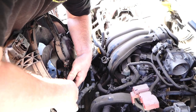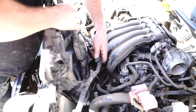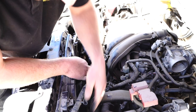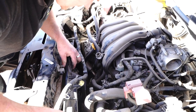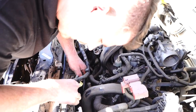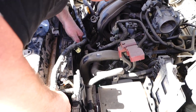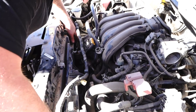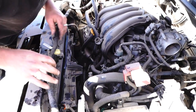Wiring loom up and out of the way. Dropping the fan into where it belongs. Once you've got it down in the hole, bring it back over to the right. Remember, it has to line up down the bottom as well. I'm sure you guys can use your eyes and line up the little clips down the bottom. Basically finding where the sweet spot is. I've found mine and clipping it into place — it should be an audible click.